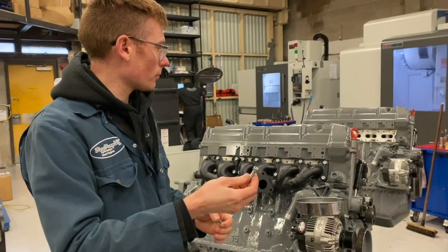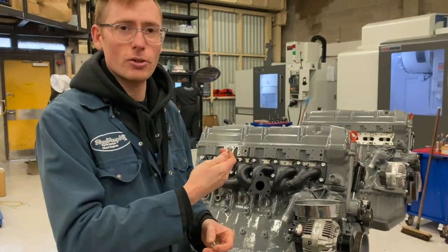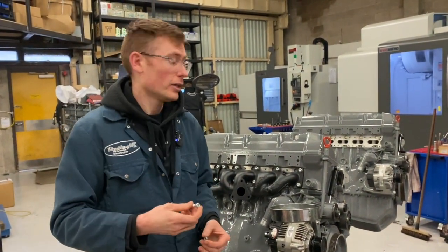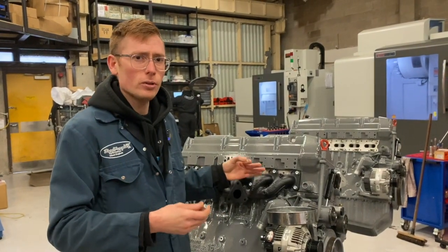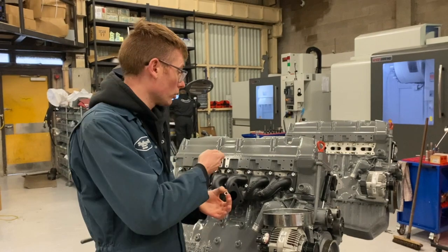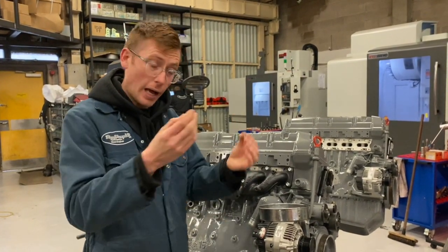So these are the bolts I actually eventually settled on. The studs are great but they're fiddly, they're a pain, they take ages to install and there are no benefits in my opinion for holding a manifold on. It's not a strength issue — we're just wanting to hold that manifold on in a fairly easy-to-remove-and-install method, and this works great.